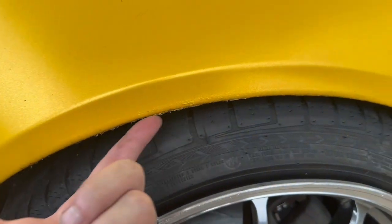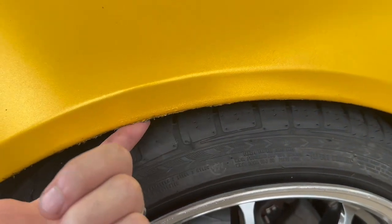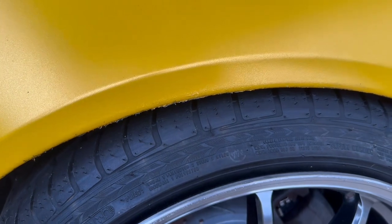We're all good. So it didn't make the car any lower or anything — that's not really the purpose of what that is. Again, it's just to give you more clearance so your uppers don't hit your strut towers. I do have my dampening up all the way on the front and the back, and I think I have 18K in the front and 12K in the rear, so it is very bouncy. But I also did that partly because of the fender situation — if you look here, I've already rubbed through in some spots, which is part of the reason why I bought the wider fenders and everything.